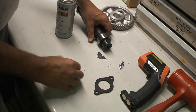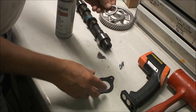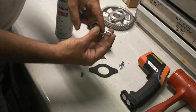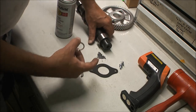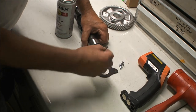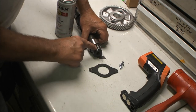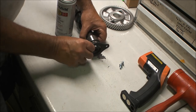The first thing you want to do is put in this spacer ring. It comes with the thrust plate. It has a chamfer on one side — the chamfer needs to go toward the camshaft. So you put that on first. Second, you put in your keyway, the Woodruff key. You're going to take a hammer and just tap that in until it seats into your camshaft. After that, you're going to put the thrust plate on.